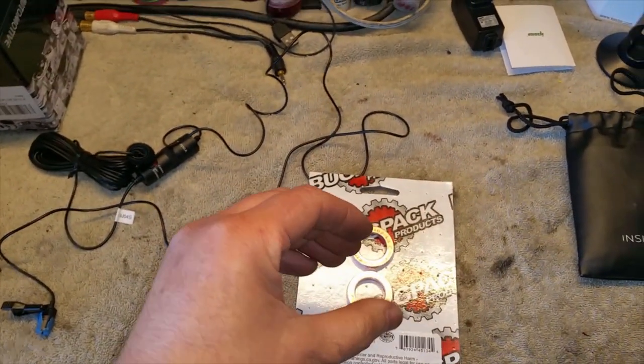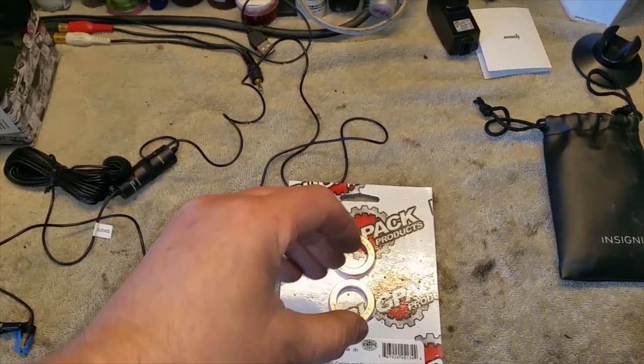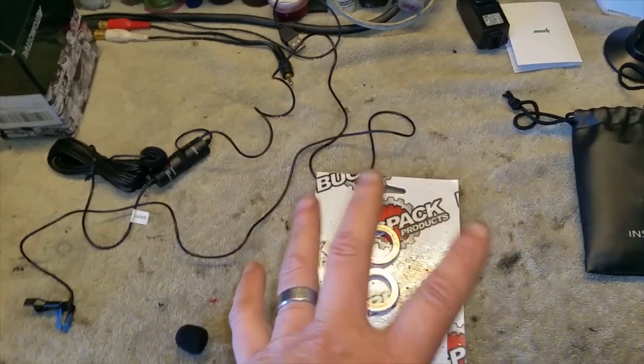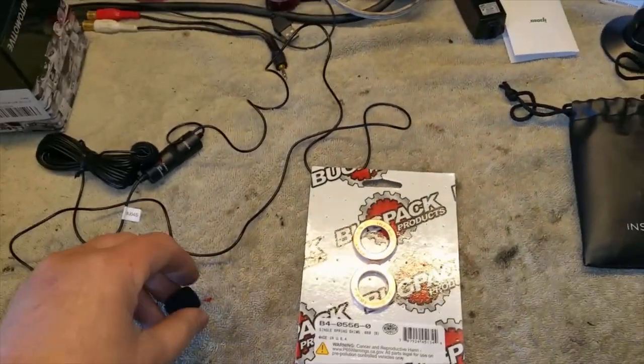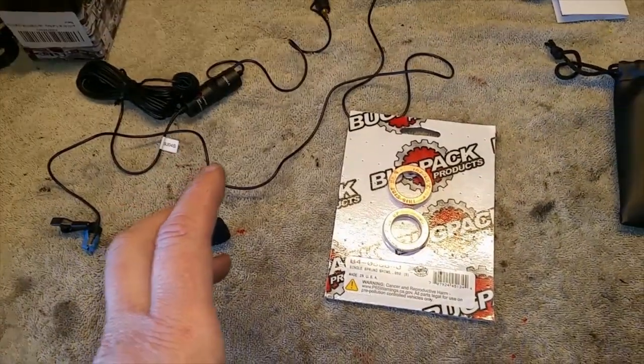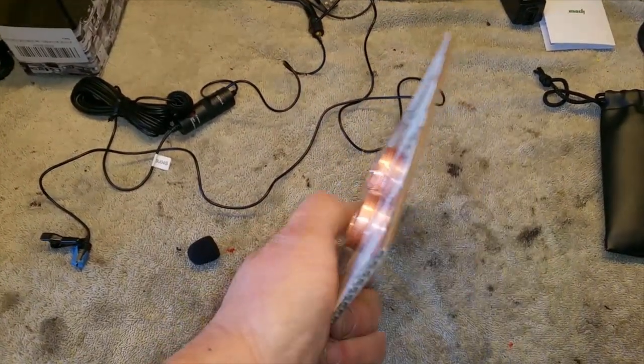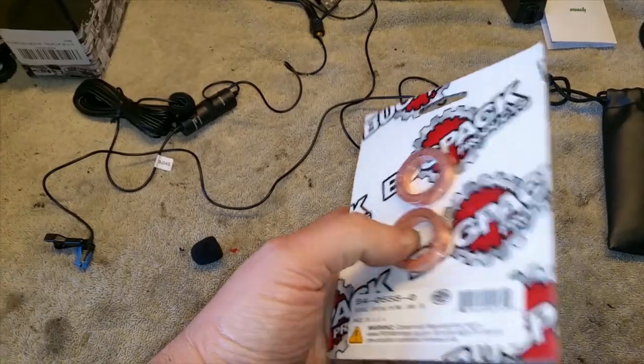When the spring is spinning, it tightens up, and as it spins and spins, it loosens up, and I get the clickety clack. So I just don't want to rev the, out of it, because I'm afraid I might break a valve or something. So we're gonna remedy that. I'm gonna install that valve spring on the cylinder number 4. So that's gonna be interesting.